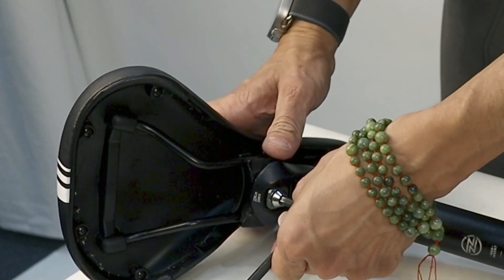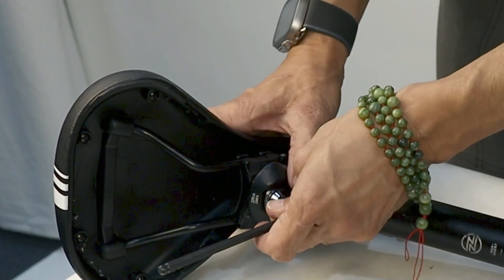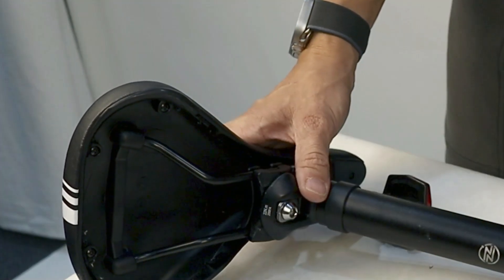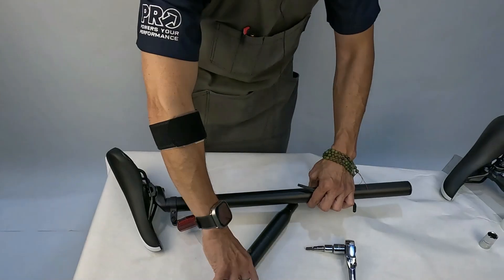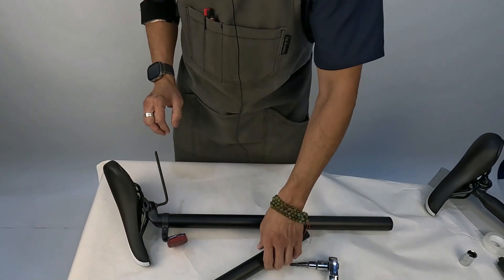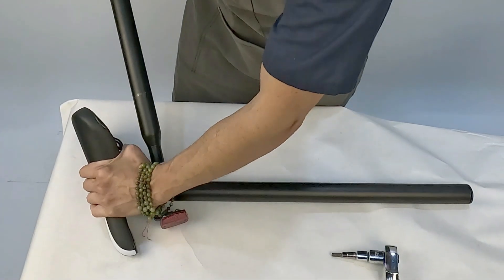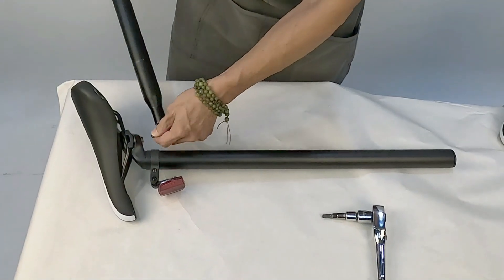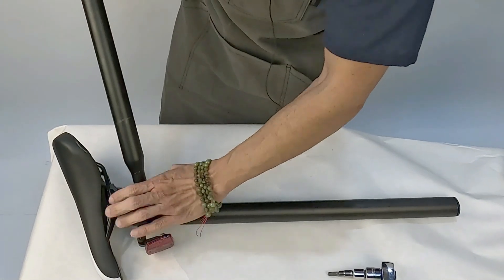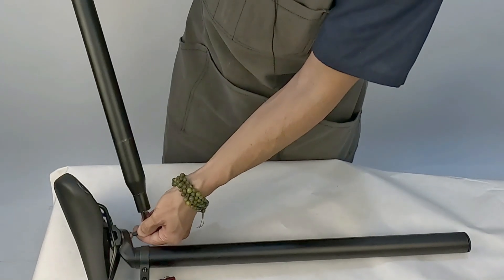Once you've got it hand tight, you get back to that bar or tube or whatever you were using for leverage. I'm going to flip the saddle around since I'm tightening it now, and I want to use that leverage. Get my breaker bar, and again I'm just going to use gravity — hold that saddle and just push down to tighten, then readjust. If you have a torque wrench, definitely use a torque wrench set to the appropriate setting. But in this case, I'm going by 30 years of experience and feel.